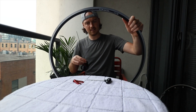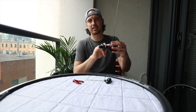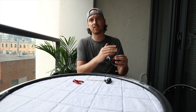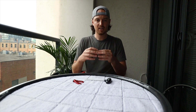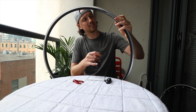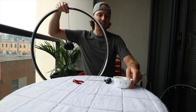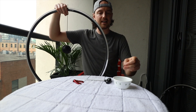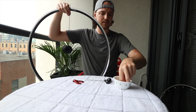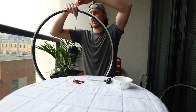This is actually an asymmetric rim. If you buy an asymmetric rim, it'll be a little bit more centered between the two hub flanges, and my hope is that I'll be able to get more even spoke tension when I eventually build up the wheel. I'm going to put this first spoke in right here — the asymmetry of the rim is pointing away from me, which is perfect; I want it pointing away from the drive side. This rim comes with washers and spoke nipples, so you need to build it with washers. I'm going to put a washer on first, then a nipple, not threading it on completely — just enough so it holds.